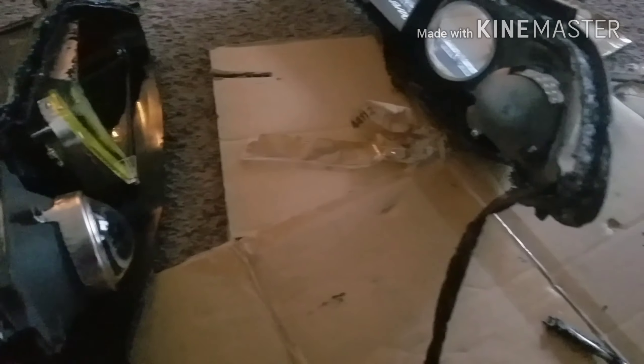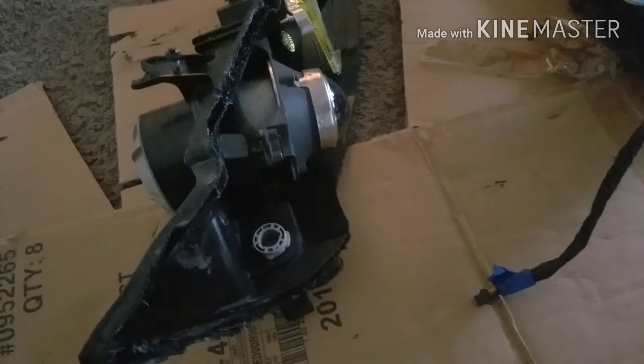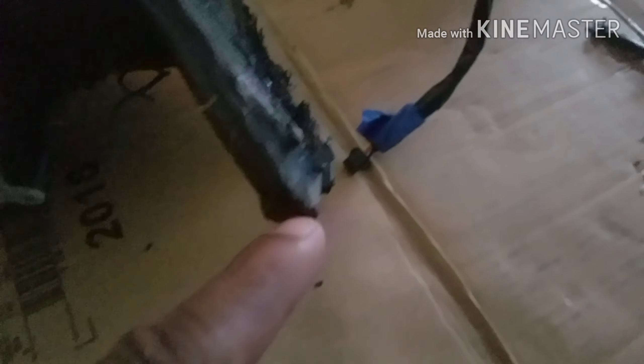Got them split. For anybody trying to mod S15 headlights, just want to let you know in advance: outside of the headlight sealant they use, there are also a couple of screws you're going to have to take out. You don't want to just go in and pry — there's a screw at the very end, and these actually hold the lens in. There's a screw here, a screw here, one on the top side, one here, and one on the bottom.